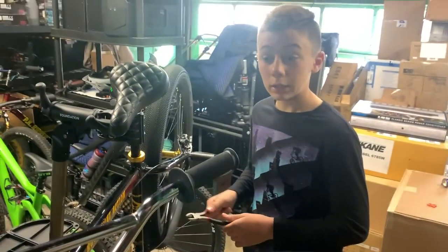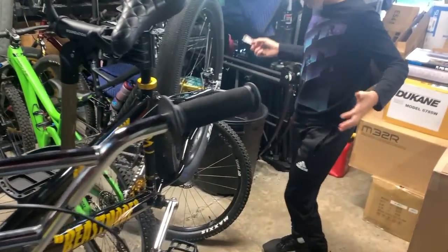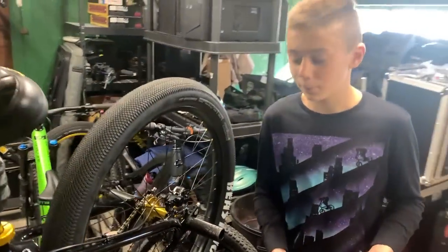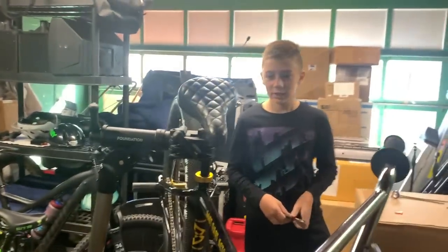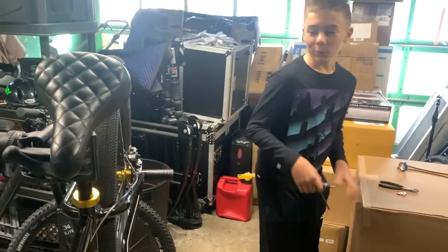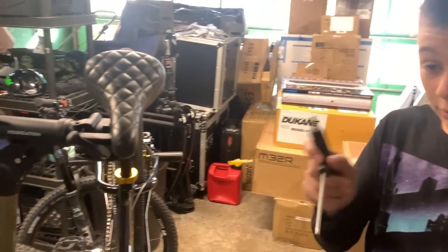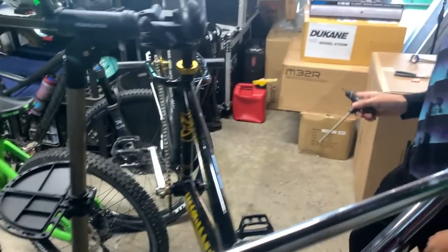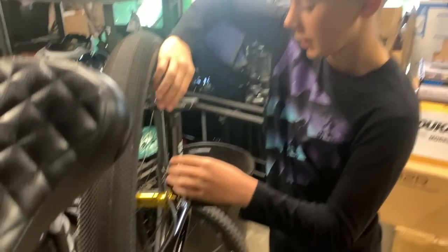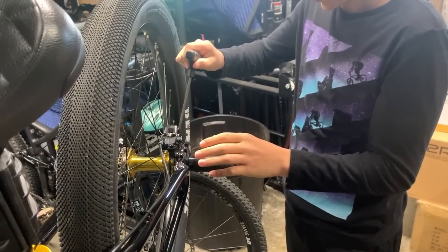And so now I guess all we have to do is adjust the caliper. It's pretty much adjusted, but it has to be tightened. It's different for different bikes, so you might need to adjust it. But this one, I don't think it's adjusted. So now I'm going to take my Allen key. Thanks to Mr. Coleman for helping me out here. He's going to hold the brake just like that, and I'm going to tighten it, because remember, they're still hand tight, not fully tight. So we're going to tighten it like this. I'm going to crank them down in a second. Just tighten them evenly.